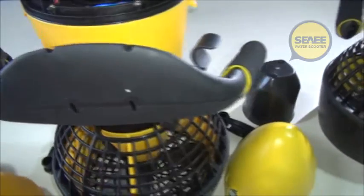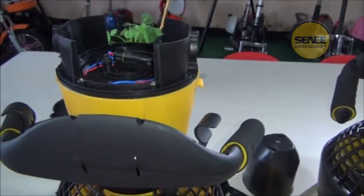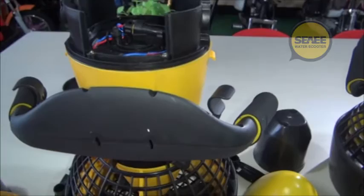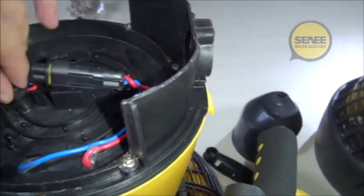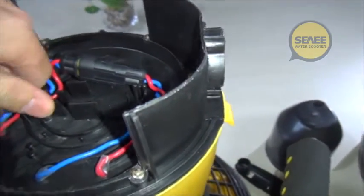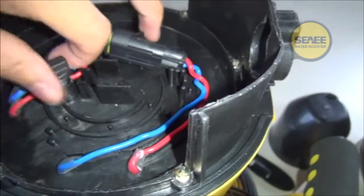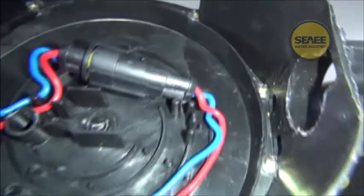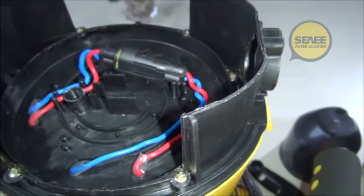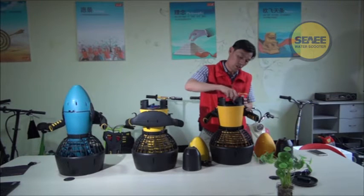If we don't keep the air pressure balanced between the inside and outside, the C-Scooter could have a pressure burst — the air pressure not staying balanced, just boom. So here we have installed a valve. Every time we charge the battery, we just screw this out so the air pressure can stay balanced while it's working. After the battery is charged, we fit the screw back inside. The screw is also plastic.